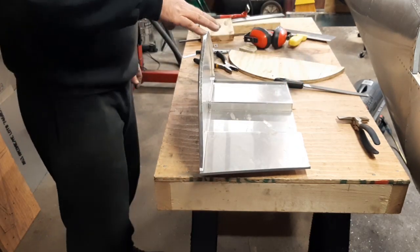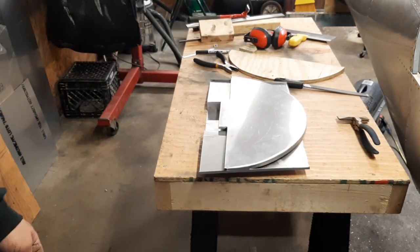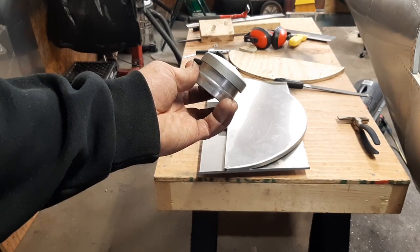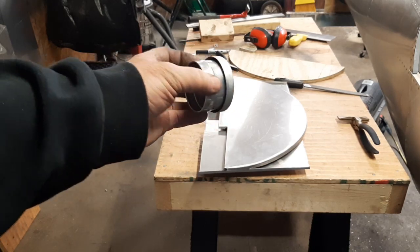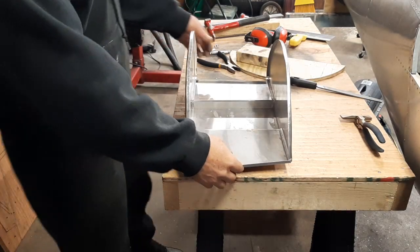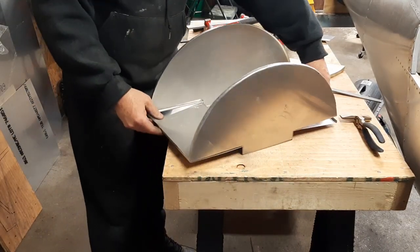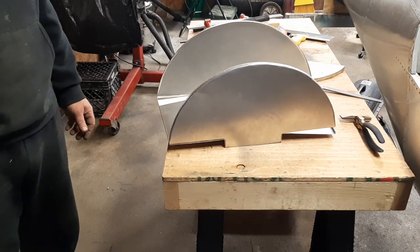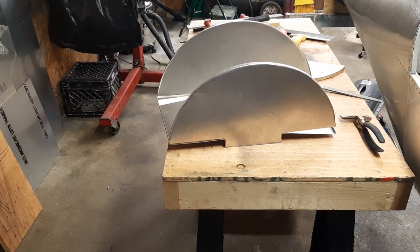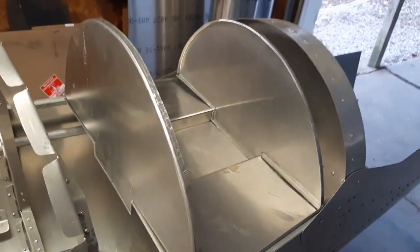The smaller front piece goes here, and that piece folds around the top on the top piece. We've got a filler neck and cap that goes in there — cut a hole, weld it in place — and then we have a threaded bung to put on the bottom for the fuel outlet. Here we have both the front and back pieces test fit together. Everything looking really good — a couple of little taps here and there. Once you start putting a few rivets into place it'll line up beautifully. Let's see what it looks like setting in the plane — looks like it ought to work nicely.